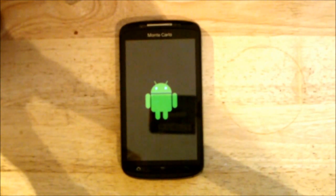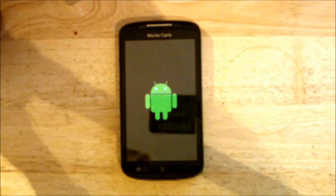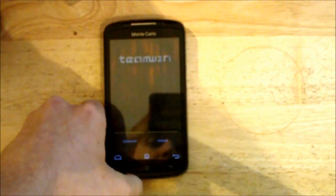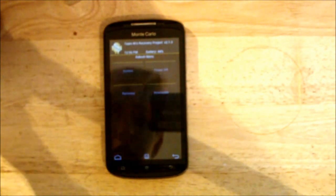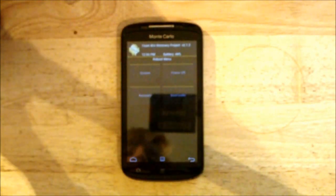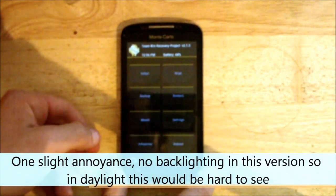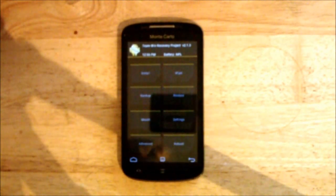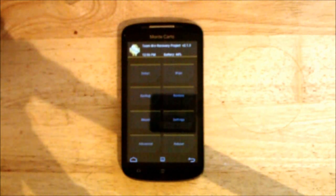Clockwork Mod Touch was Koush's alternative to this. Sorry guys, we had a bit of an issue — it just didn't want to work properly. I found out that you could not access it from the power menu reboot into recovery. Had to do a battery pull, hold the volume minus button and power on. Also, on this device it doesn't seem to be backlit enabled.